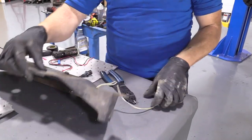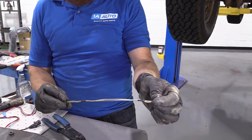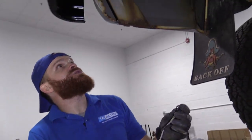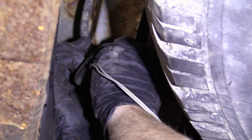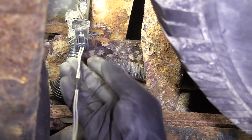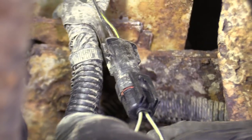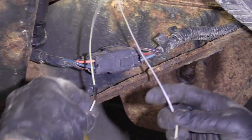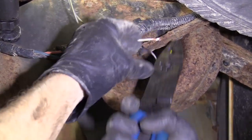So we have our plate light here — the original plate light and the wiring harness for that. I'm just going to come over here and give it a little snip, and we're going to be able to reuse this part. We'll go to the vehicle, plug it in, figure out which one of these wires should be positive and which one should be negative, and then we'll be able to continue. You can take a peek up at the top right here — there's a solid black wire, and then there's one with a stripe. The one with the stripe is the positive, so we'll just follow that down and make sure we don't mix those up. This one right here is the positive, so I'm going to splice that right now.